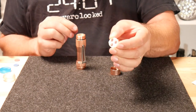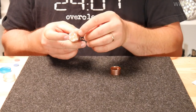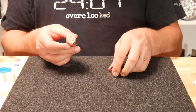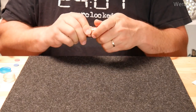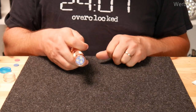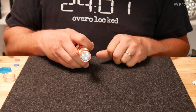Having the optic in hand, there is only one way it can go correctly so you can mount the gasket — it looks like this, and then it goes easily back the same way it came out. Just be sure that the feet go into the holes. Push it back and have a quick look if the LEDs look the same underneath the optic. Screw the bezel back on — and here it is. Nice blue glow, cool thing!